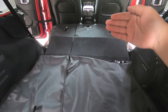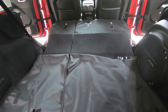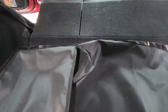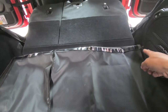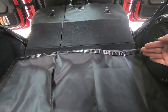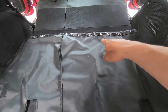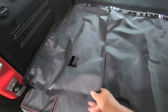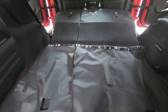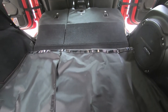Before velcroing the panels to the backs of the seats, we have one last adhesive-backed velcro piece to add — a long piece right in the middle. With the seat backs pulled down just enough to see where that piece lands, we'll flip it up, see where the velcro needs to go, and install it there. Once that adhesive-backed piece is installed, pull everything nice and taut. Then we'll do the seats themselves, which just velcro right to the factory carpet — those are really simple.